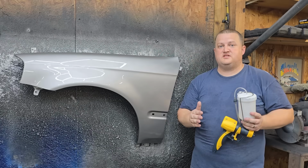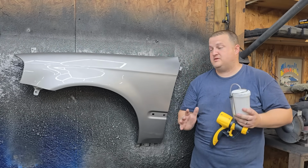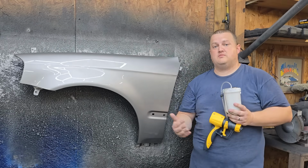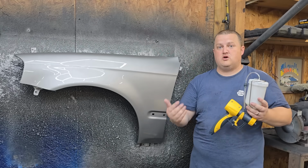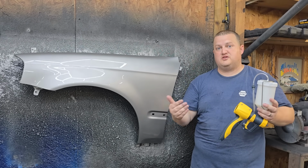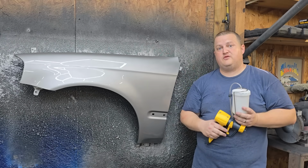But, for purposes of this, it was about 75 degrees as opposed to 95 or 100, which I've been spraying in here lately, which has been absolutely brutal. And I was able to get much better results because I was painting in more ideal temperatures. And that's just kind of how it goes. And your reducers, your hardeners, stuff like that greatly affect how your outcome goes as well because it allows your paint to flow out. So 2 to 1 mix on the paint today for the Rustoleum, guys.